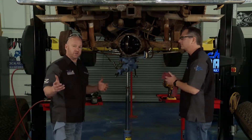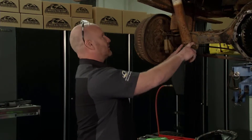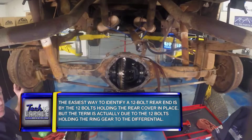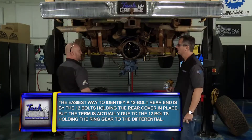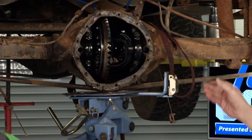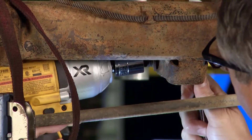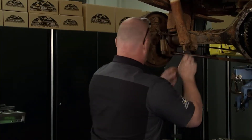Same thing — just like if you're working in your driveway, you've got to have it stable at all four corners of the vehicle to tackle this project. I'm going to go ahead and get this shock off the upper U-bolts — I got them cracked loose. The weight's going to be free-floating at that point and we can just back it all down. Sometimes you have to encourage these lower mounting bolts out. This one got lucky — that came right out nicely.